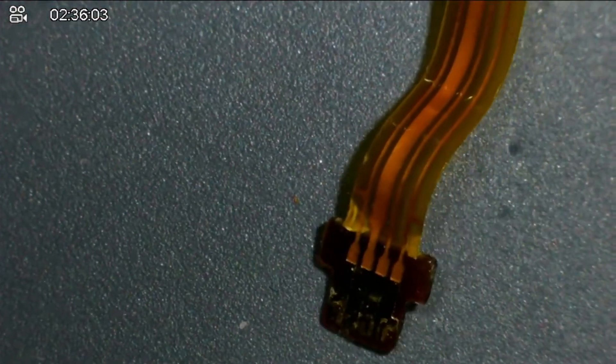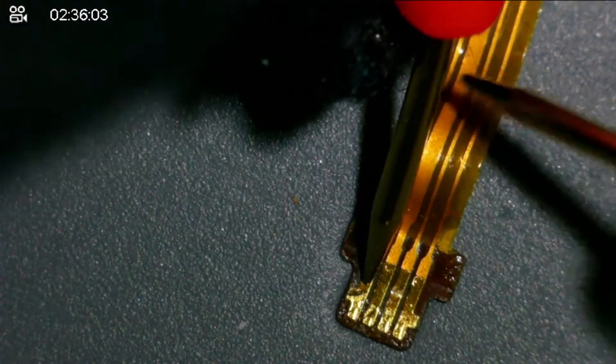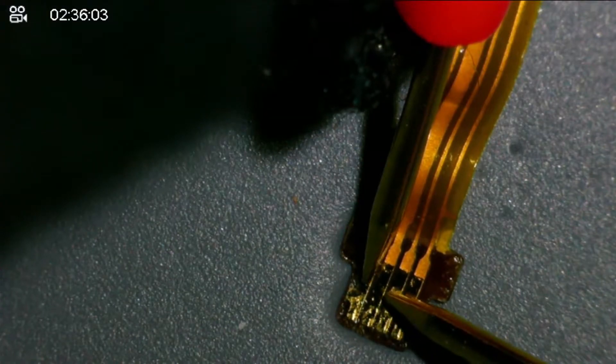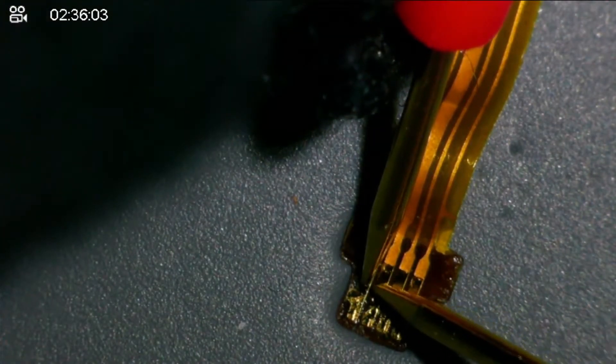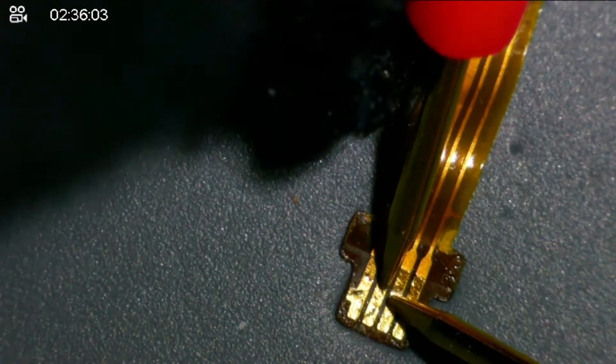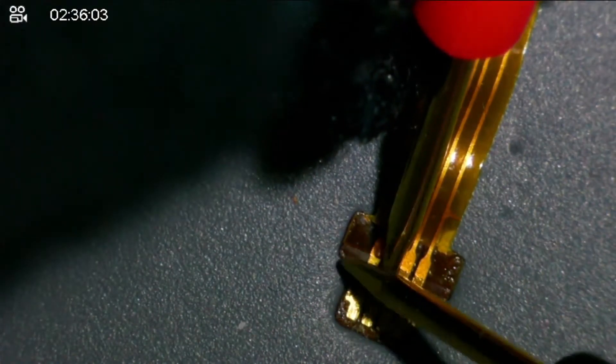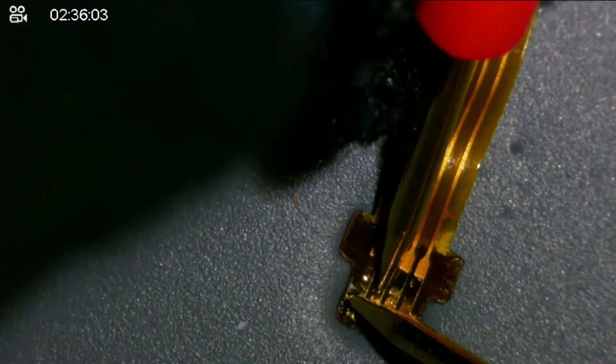You see this little button right here? Put your finger on it — don't press it yet. We're going to get this connector pinned down and touch here. Press the button. There's no connection there. Now press one of the other buttons — the one that makes it beep. See, it's beeping — that's the volume button. But if I do the power button, there is no connection. So there's a break in this cable somewhere. That means it's definitely the power flex.